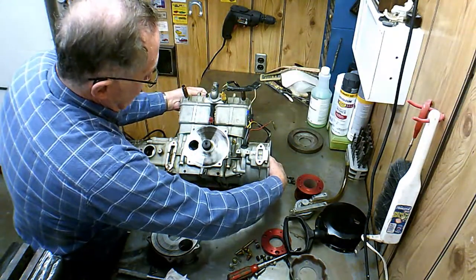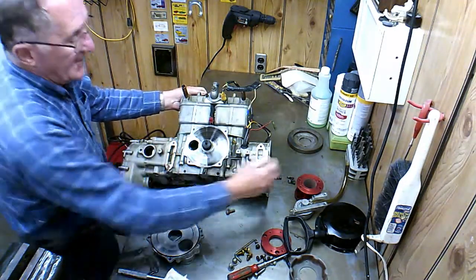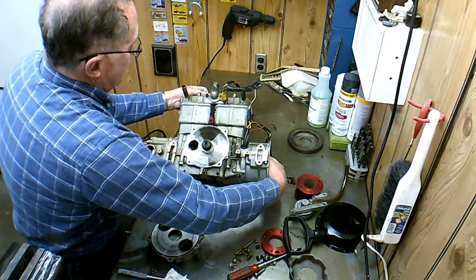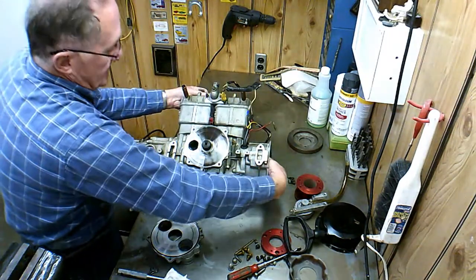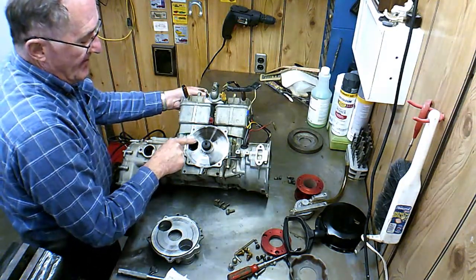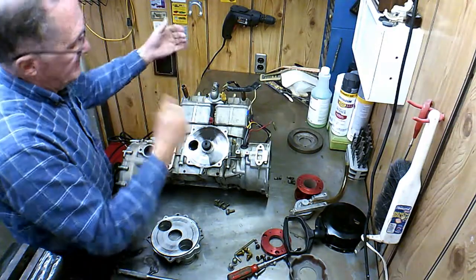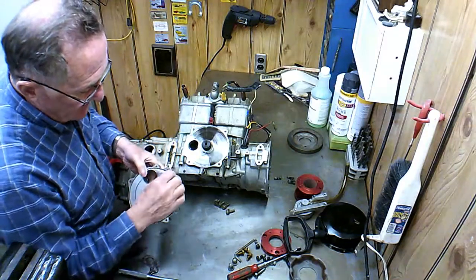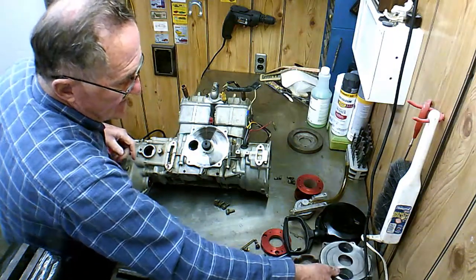What you do is you rotate the engine the way it rotates. I'm doing it on this rear cylinder here, which is a power takeoff one, is the one I'm sticking this wrench in. And you'll notice at top dead center, when you feel a piston, you can feel where the piston's at by this Allen wrench. And when it gets to top dead center, right there is where that rotary valve should go on. It's just even with that top edge of that port. In other words, when the piston continues down, it's going to cover that port. It's ready to close that port. There's a little tiny O-ring seal here you got to keep in here with this for the rotary valve cover, but that's just used as a gasket.